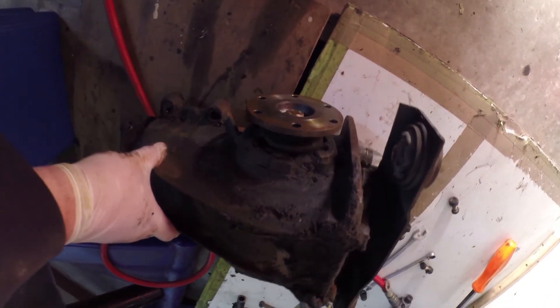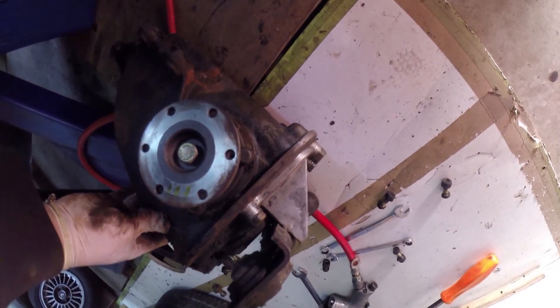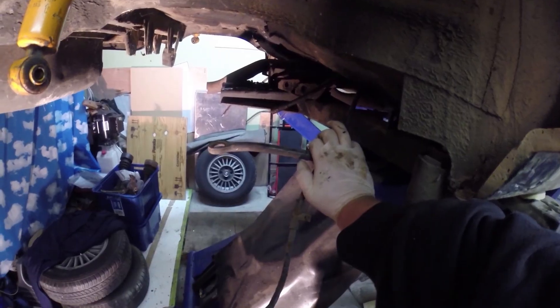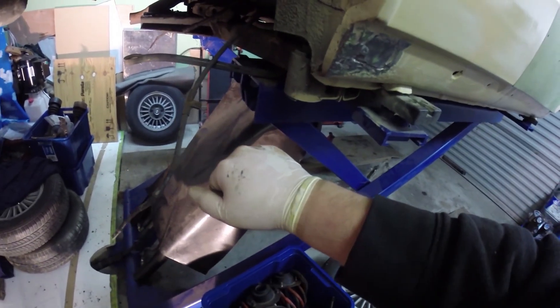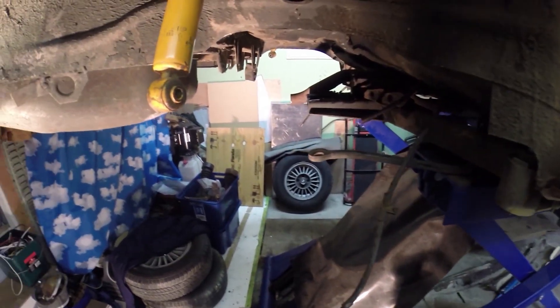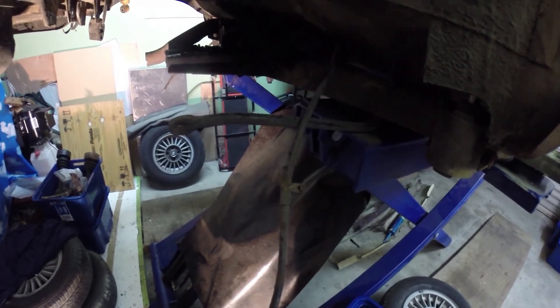There it is — ye olde diff. Actually it looks pretty damn clean. Someone must have taken that apart — it looks way too good. So we have the diff out. We've got to cut that exhaust off further up, throw that away, and pull the drive shaft out as well. We've got the bolts off here for the rear subframe but they're on very large bolts that can't be taken out easily, so we have to lift the car up and drop the subframe out. We'll just lower this thing down onto a transmission jack and let it fall out.